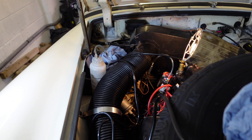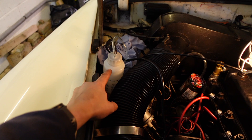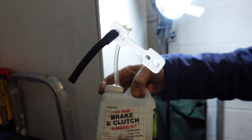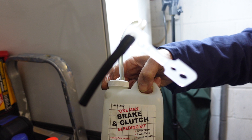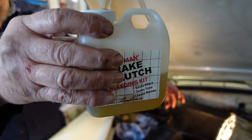So we're going to try old school. There was clear fluid passing through but not enough to allow the clutch pedal to pressurize itself. I'm going to do it how I used to do it. Goodbye pressurized bottle of air — we're going to use one of these. To the layman's eyes it's a bottle with a bit of loose pipe attached to it, but there's something rather clever about this particular bit of hose that had bypassed my knowledge. We're going to detach all the Easybleed stuff and have a crack at reassembling with Dave's tool.